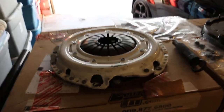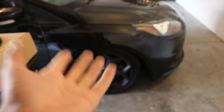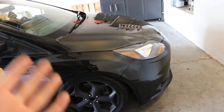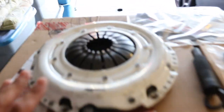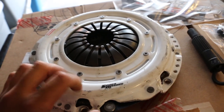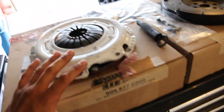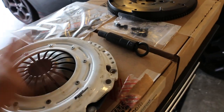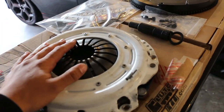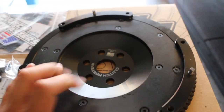Let's dive into this thing. Before anybody says anything like 'the clutch looks damaged, it looks used' — the engine in this car actually unfortunately blew. Cisco had some guy come out and they swapped the engine, so it's only got about 16,000 miles on it. But the guy who was installing the engine tried fitting the clutch on the OEM flywheel. If you're familiar with these cars, they have a two-piece multi-piece flywheel, which isn't really compatible with most performance clutches. When you upgrade your clutch, it's almost mandatory to upgrade your flywheel too.